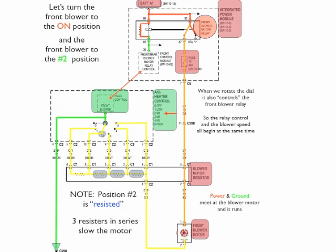But notice that we've got connections at 1, 3, 4, and 5 as well. Now you may be asking, why is that? Well, before on position 5, it was connected directly to ground, and now it's number 2 that is connected directly to ground. But 1, 2, 3, 4, and 5 are all directly connected to each other as far as continuity goes. The wires are physically touching, and there's no opens in them.